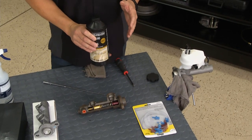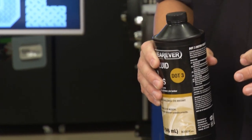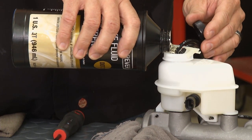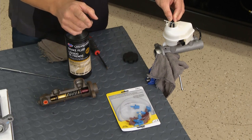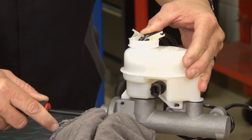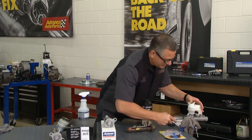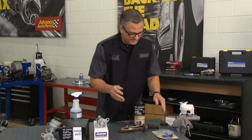Make sure you use the right brake fluid — there's DOT 3, 4, 5, and 5.1. DOT 3, 4, and 5.1 are glycol-based; DOT 5 is silicone-based. We're using DOT 3. The higher the number, the higher the boiling point. I got a bleeder kit from Advance — just hoses and fittings fitted into the master cylinder ports — with the hose ends submerged in fluid so air purges back up into the reservoir rather than into the system. You can see the bubbles. Throw a couple of big strokes and some small ones to push all the air out.